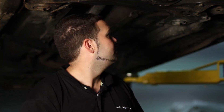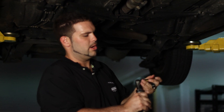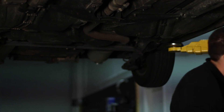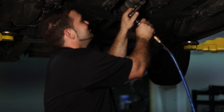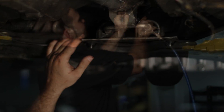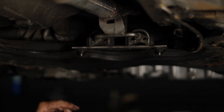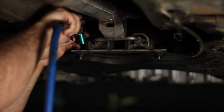I got those three nuts out. Now we're going to go to the back and take out the nuts on the exhaust clamp. For this you're going to need a 17mm socket. I already broke them loose — it's a 17mm, not a 16mm. I only have two more bolts to take out and then the down pipe should be free, other than moving the exhaust clamp out of the way. These are 13mm bolts again, so use a 13mm socket.